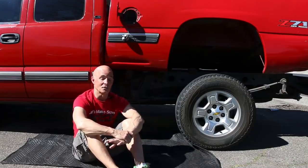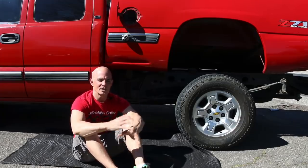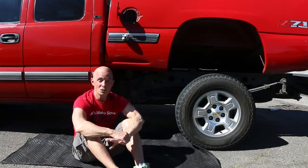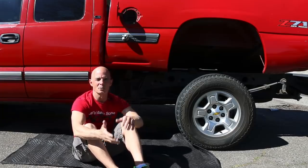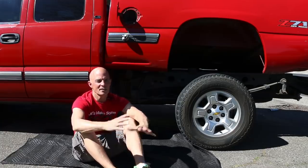And as we see, it means that there's basically no boost on the 4.8. So it's providing a certain amount of airflow, and because the motor in the case of the 3.8 liter, the 3800, is not using all that airflow, we see a restriction between the blower and the motor, and that's what we see as boost.